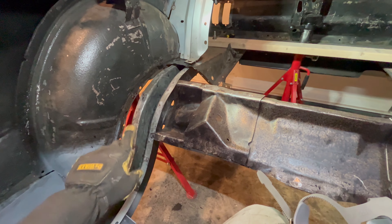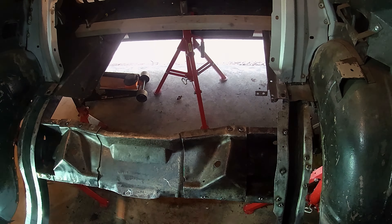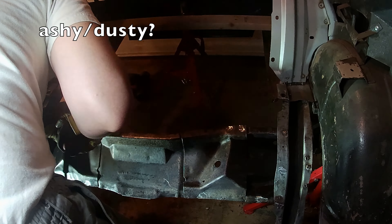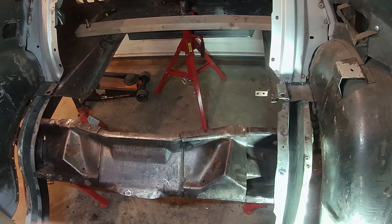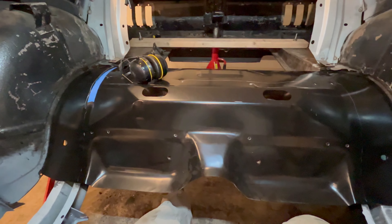I've got all my flanges straightened out. I'm going to go around with my welder and weld up some of the spots where I went a little too deep, then grind them flat. I didn't think Ford galvanized the rear frames — I knew they galvanized the rockers — but the way these have no rust on them and have that light-looking corrosion as opposed to rust, it looks like a galvanized coating. So just to be safe, under my welding mask I'm going with a full cartridge respirator. I also have a vent fan circulating air and I'll crack the garage doors to get fresh air coming in so I don't breathe those heavy metal vapors.